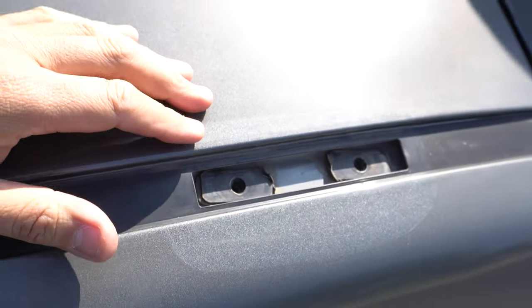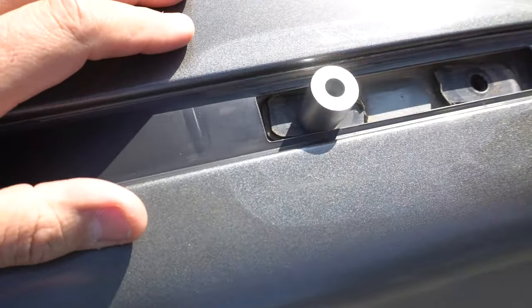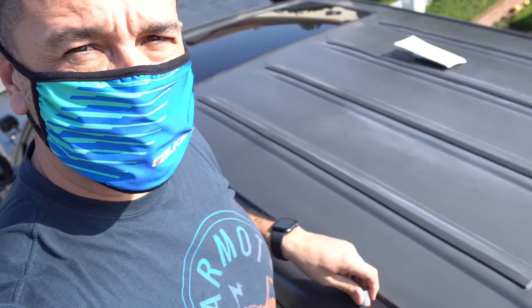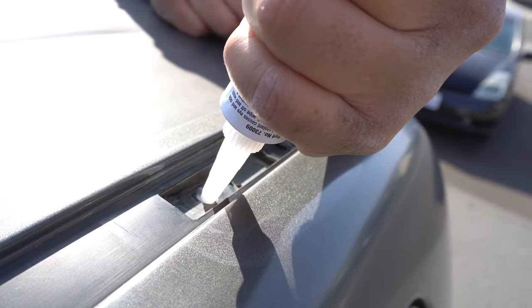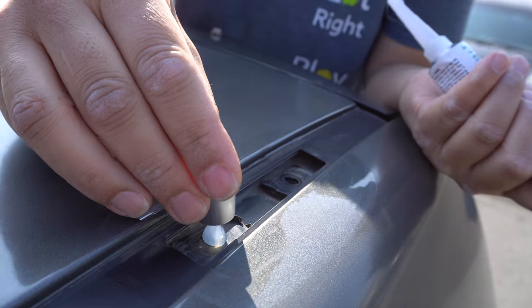With the Land Cruisers, what we noticed is that the opening for the bracket or spacers is a lot larger, so you can just drop them right into place without having to cut them. That includes the middle ones and also the front ones — no trimming needed for this particular model. Some Lexuses you might have to do some trimming. Before you go mounting your rack, make sure to put your spacers on. Use clear silicone so you can see where your hole is when you put your spacer and bolt in. Be generous — you want it to bubble up like that. Take your spacer and just set it right on top.